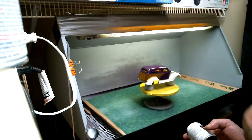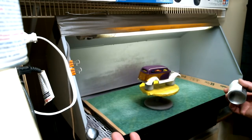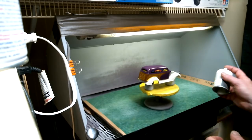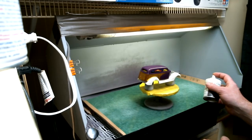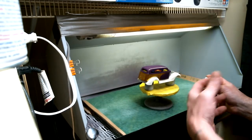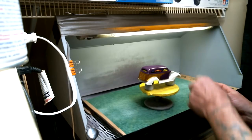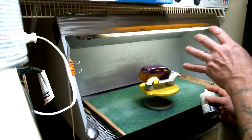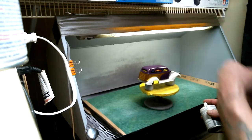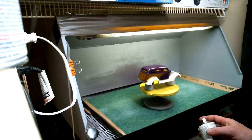With this coat, we're going to go a little bit heavier. We're also going to be putting the second coat on the hood itself. Same technique. We're going to stay about the same distance away as we did before, but put it on a little heavier because, like I said, it's lacquer. It's going to pull down, so it's not going to be as thick as when you first see it go on. It also gives you something to wet sand and buff to make sure you don't cut through into your color coats. So we're going to click the booth on and get to spraying.